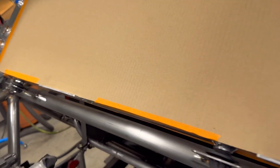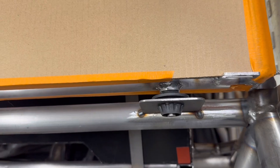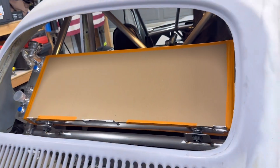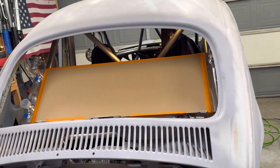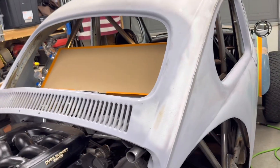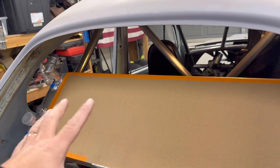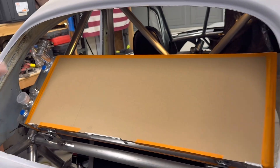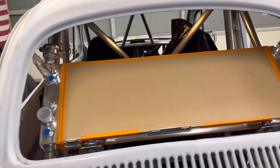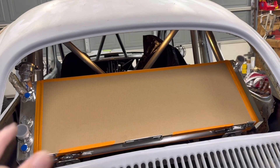Down on the bottom we've got the tabs in with the rubber isolators, and those worked out really well. The radiator is in, it's leveled, and everything looks good — so now I can start seeing how the plumbing is going to run. Keep in mind there is going to be a fan shroud with three fans here, probably 10-inch fans. If anyone has a hookup on Spal fans, let me know. I'm probably going to make my own fan shroud out of carbon fiber.